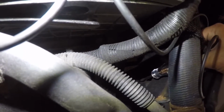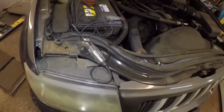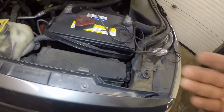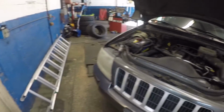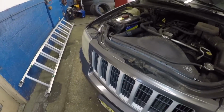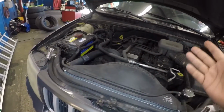And the reason why there's no power here is because the car is not at the right temperature. So we're gonna wait a little bit and the fans should get power in a little bit. Because this car overheats, as the customer said. He was trying to move the car from point A to point B because there was a cleaning coming, so he was there 15 minutes with the car running, and it overheated.